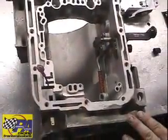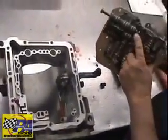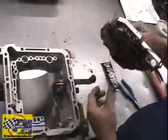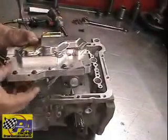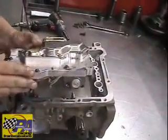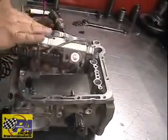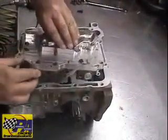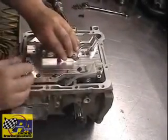As with all our valve bodies before, the important thing on this valve body is to engage this valve, the manual valve, into our linkage on the case. So we'll get a different angle and we can see how that's done. Take the valve body. As you can see, the trans brake valve bodies, when you buy them, they do come wet. They have been tested on a dyno. They're tested for pressure, lockup time, release time. So it is fully checked when you get it. It's a little messy, but it makes for a better and easier installation.